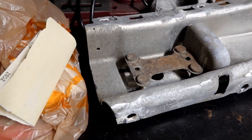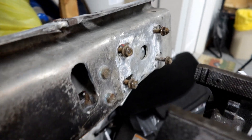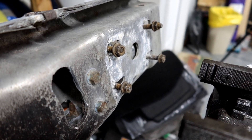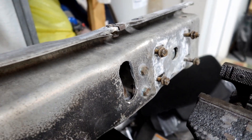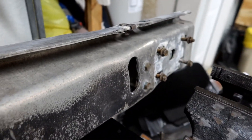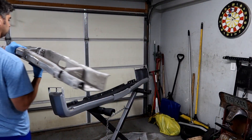I'm going to tape these guys to the inner bumper structure because they love to just fall out. I should probably spray those with penetrating oil too, because they are threaded as well. That little bracket loves to come in and out, so let's take the nuts off as we get this all together and we're sliding it on the car — basically onto the bumper shock absorbers that we flattened. We'll tape down that bracket.